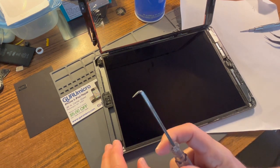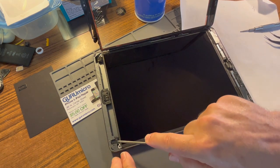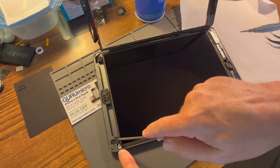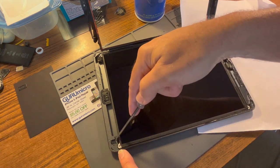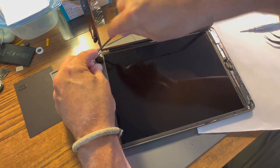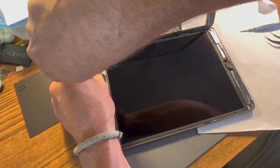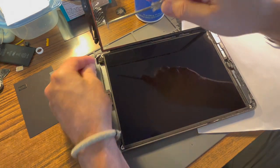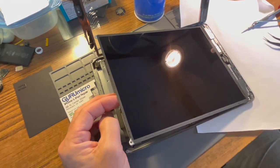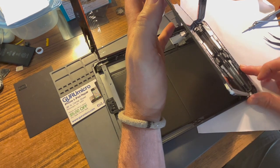Another tool I use is a pick — it's a very strong rigid pick. For this particular phase, these are great. You could probably do it with a little flathead screwdriver, but you need to go underneath this edge right here and lift gently. These are glued in — they put a rubbery adhesive. I'm going to go right underneath this little leg where I pulled the screw out, and lift that gently. Now I can actually use this hook to help get my finger under this. The bottom ones you don't have to do that because it's now going to lift this way. Again, this is important because you don't want to tear the cables on your LCD screen.